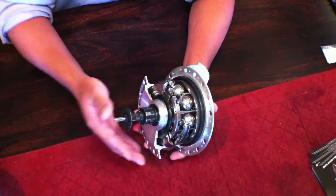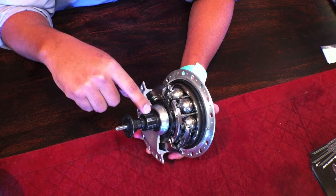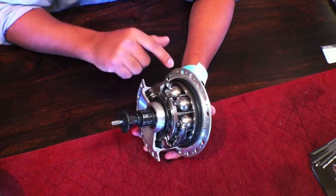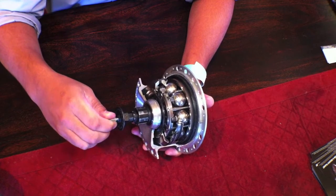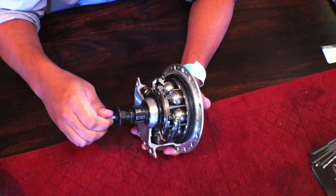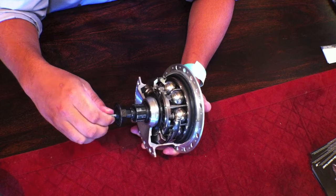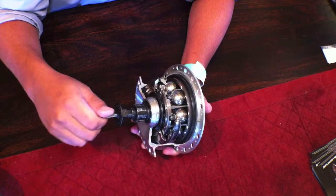The device operates on a series of rotating balls. The power path comes in from the freehub body to the driver to what we call a traction ring, which rotates these balls in unison. These balls then react against an identical traction ring connected to the hub and wheel. The ability to tilt these balls back and forth — changing the contact diameter where they touch the planets — creates a 360% ratio range, more than many other internally geared hubs, with a much simpler power path and less that could potentially break.